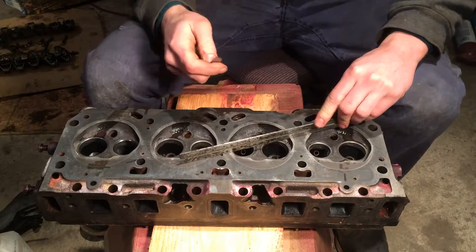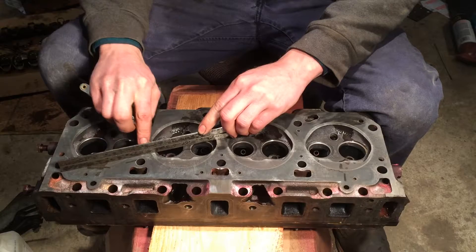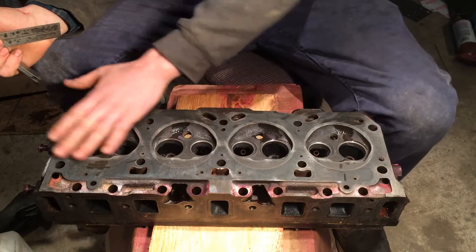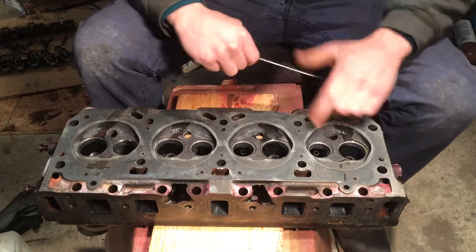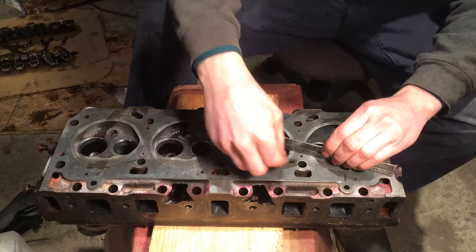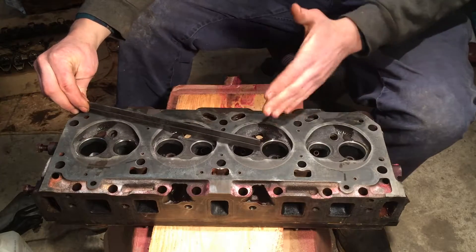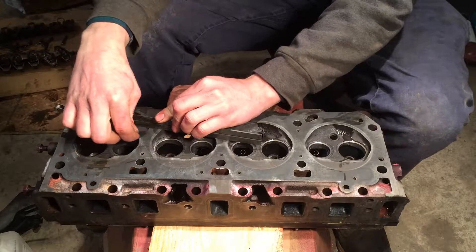As you can see, I can't fit my two thousandths in, so these seem really good. That's another reason why I wait, because before you do the dye penetrant, you go over this with a stone, so it helps to knock down any edges that would be sticking up. So just go on a diagonal and try and slip it under there. That's why it's nice to have a longer one, because you can reach it the whole way across, but this works just as fine.